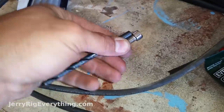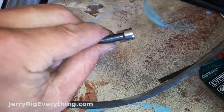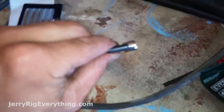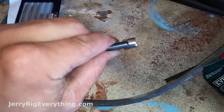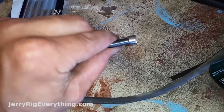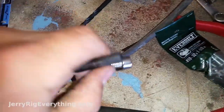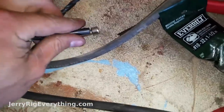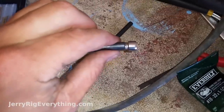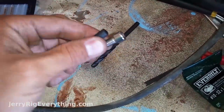When you're choosing the correct drill bit for the bolt that goes on the side to hold up the light, you want a bit that will cover up all of the threads. On this particular bit you can still see some of the threads at the top and bottom, so I'm going to switch to a bigger bit. That will make it so that the screw slides right inside the slot without gripping on or destroying any of the threads.